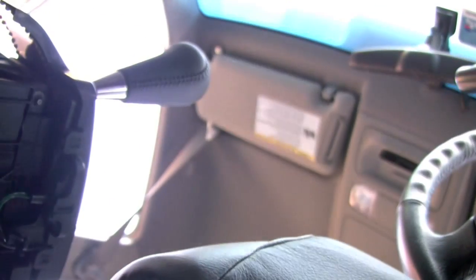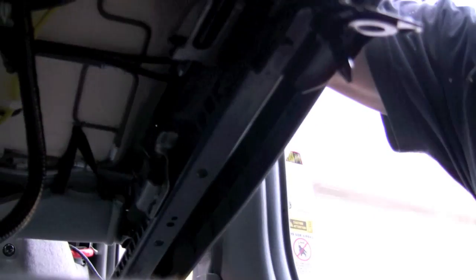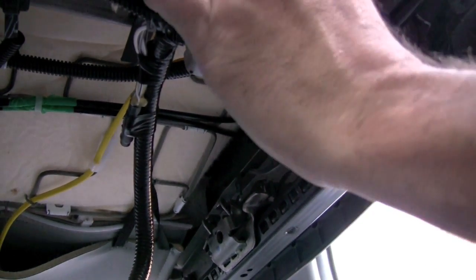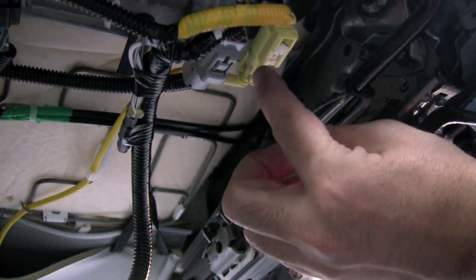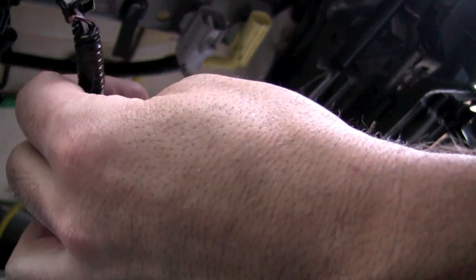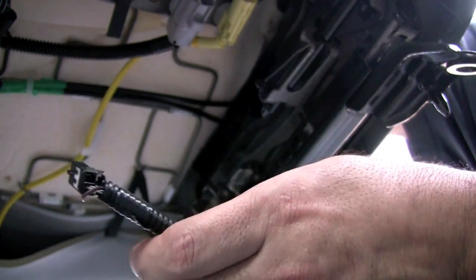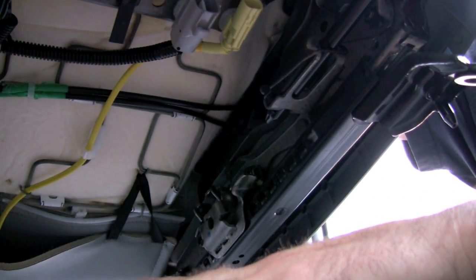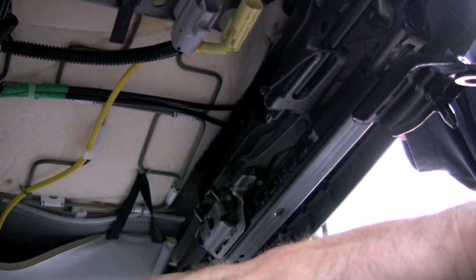I removed the four bolts from the seat. Now I'm going to lean the seat back. This one you slide forward and that pops right out. This one you squeeze and it pops out. Then the seat you just lift out and it's ready to go. That's all there is to it. I can't stress this enough - don't do any of this with the battery connected. Disconnect the battery before you start.